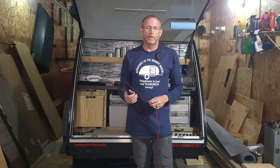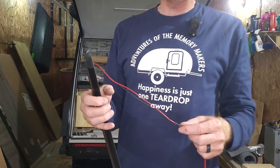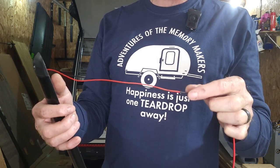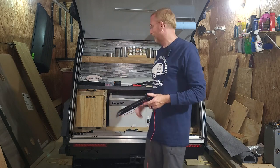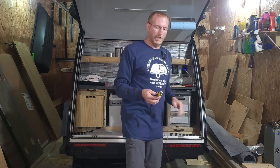Here's what I mean by staggering the joints: you can see the positive and ground leads are not side by side, which keeps the wire bundle's diameter smaller so it can go through a smaller hole. Something neat I recently discovered is a 12-volt powered soldering iron. I was soldering one day and wondered if they make one in 12 volt — I was looking right at a 12-volt auto power plug — and sure enough they do.